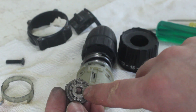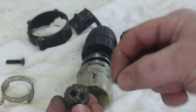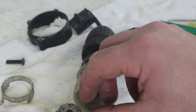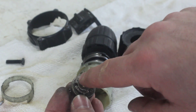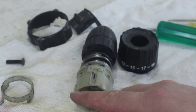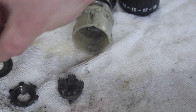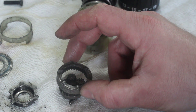Those ball bearings press onto this piece with these little ramps — the harder they press because of the spring tension, the harder it'll be for them to slip up on the ramp. So when it's really tight the gearbox is transmitting all the power into the chuck, and when they're loose they'll slip, which gives that sound. Next we have this little star pattern in the plastic housing that engages with this piece, which in turn engages with this piece. The arbor slips through here — this is the final drive into the chuck — and then there are these little cylindrical bearings. This is what's known as a sprag clutch. When the outer part rotates the inner part is free to rotate; however if you try and rotate the inner part it'll twist and force these bearings slightly out, making them catch. So the motor can turn the chuck but the chuck can't back-turn the motor. On the other side of this piece we have our first planetary gear set.